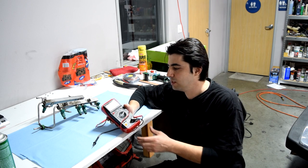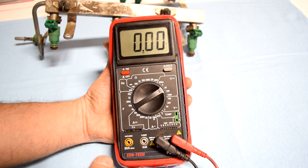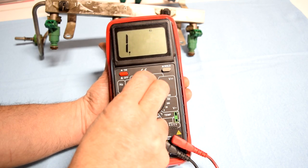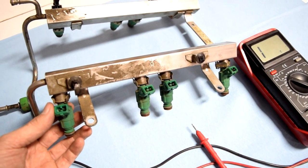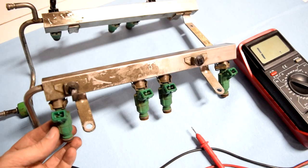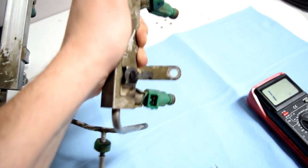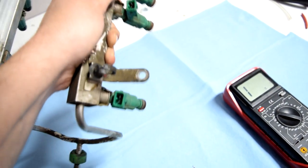The second method for testing your fuel injector is using a multimeter to do a resistance test. You can do this with any basic multimeter, and you can get them for as little as six bucks at Harbor Freight. You want to put your settings to ohms and choose 200, since our readings are going to be way less than 200. Look into your repair manual and look up the spec for resistance for your fuel injectors. Generally speaking, depending on the type of fuel injector you have, the resistance is going to be either between 2 to 6 or 12 to 16 ohms for each injector. You can also just check all of your injectors and look for the odd one out — if all of them have about 13 ohms of resistance and one has about 45 or no resistance at all, then you've probably found your problem.